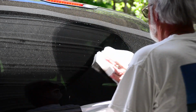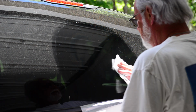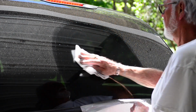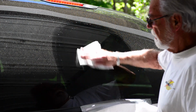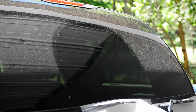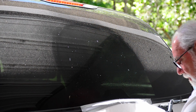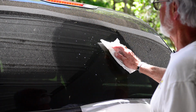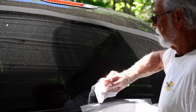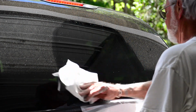Give it a good wipe, get all the adhesive residue out of there. And now we're going to put a new one back on. So we need to, I'm going to clean it twice with Rapid Tac 2. Okay, so clean that a couple of times to ensure that we don't have any remover residue or window cleaners or any of that kind of residue.